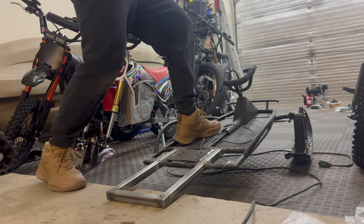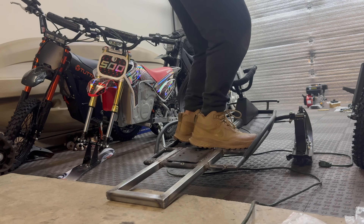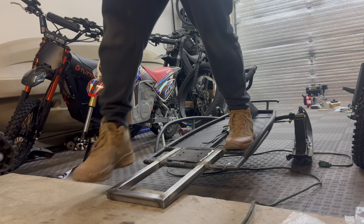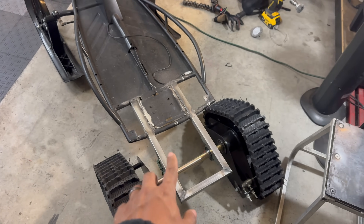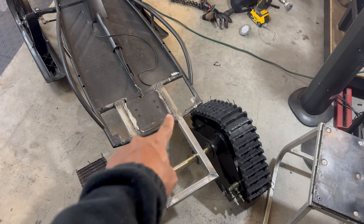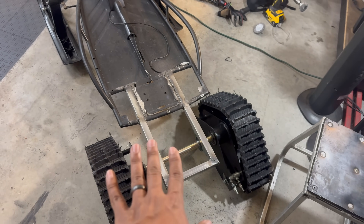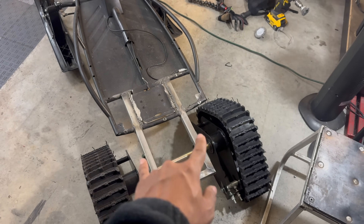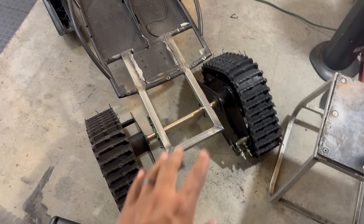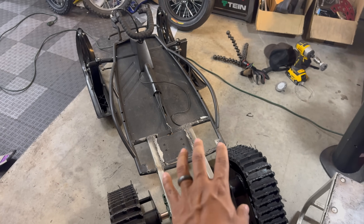These welds are certainly ugly, but the most important thing is it's more than strong enough. My main concern was the structural integrity of the frame. You might notice that the whole track assembly is slightly offset to the left about an inch — that's just because the battery tray I followed is offset about an inch to the left, but that's completely fine. It shouldn't affect alignment as long as the rear axle is mounted perfectly perpendicular to the frame. I kind of wanted it this way anyway since the Predator motor weighs quite a bit, and I'd rather have that somewhat close to the center of the chassis.